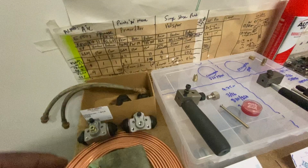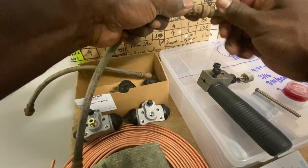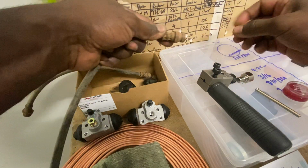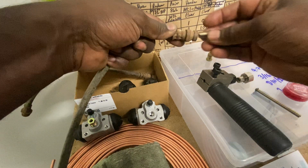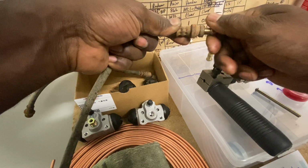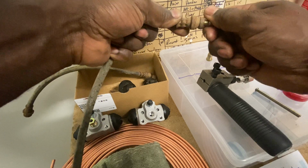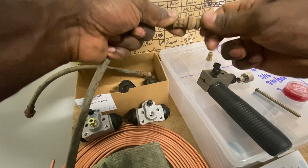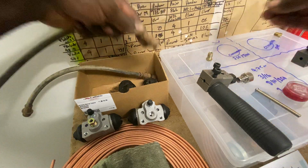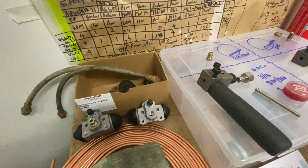Oh, that's the other thing. So these fittings are the same for these ones too. See, it goes in quite well with the SAE one. To put this in, you can't even push. Oh, you can put it, but look at that. You probably can tighten it, but I don't think it's legal. It might leak. So that's quite critical, getting these connectors right.